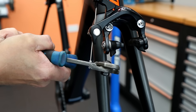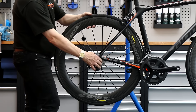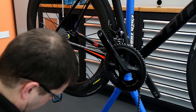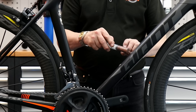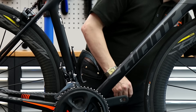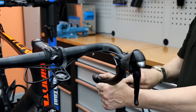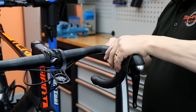I use the cable guide to get the front and rear cables the same length — a quick and easy way of matching them. Now we can put in the wheels and begin to finish the bike. Front wheel in — front brake now pulling square. Rear brake now pulling square. A lovely wax chain going on the chain set, freshly cleaned and powdered rear cassette, new quick link in there. I'm going to pop a little bit of anti-seize copper grease into the frame threads to stop the bottle cage holders binding — a little grease and not over-tightening means they'll last the entire life of the bike.